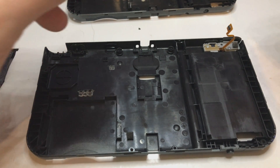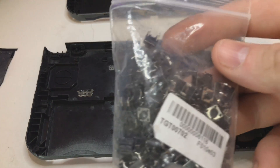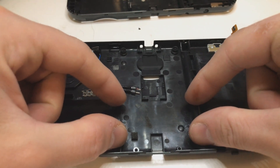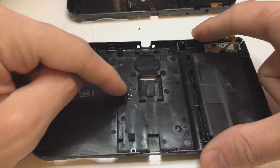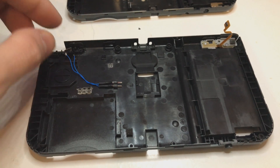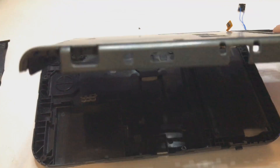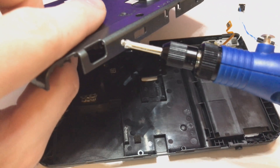For the button of the Bluetooth mod, I bought these off eBay - got hundreds of them. I made this connector because the Bluetooth chip is glued in, and every time you disassemble the 3DS, this plate needs to stay connected. So I made this - I'm not sure what to call it - but I can plug it in and out so I can take it off whenever I want. That's just a convenience thing. To make the button fit, I need to make a hole like in my old one, which I made with a Dremel, and it goes right in there as a perfect fit.